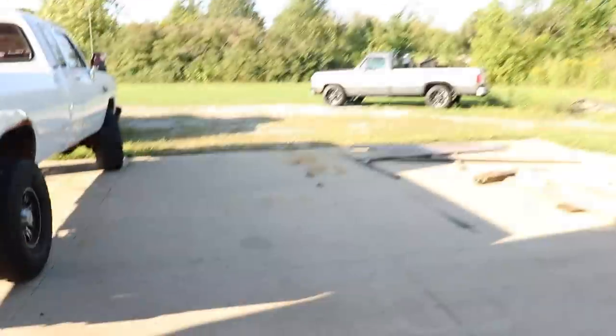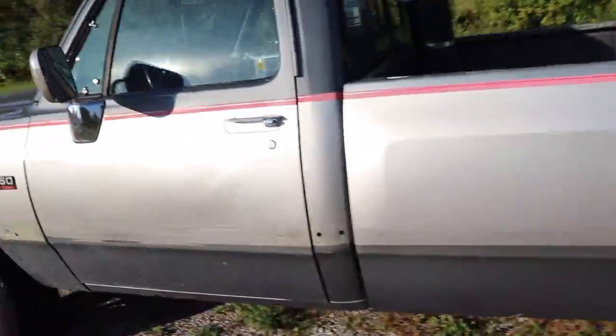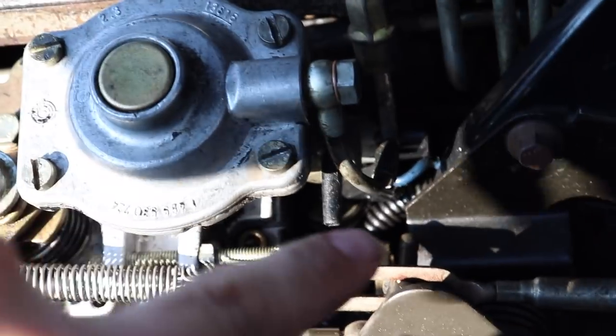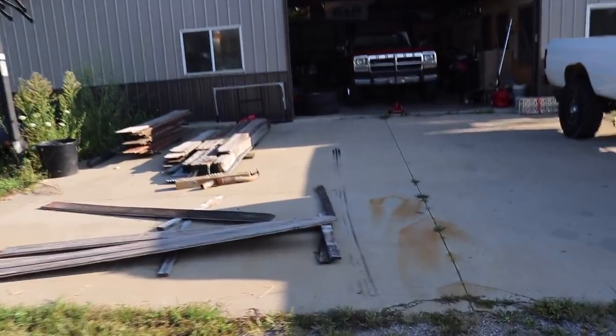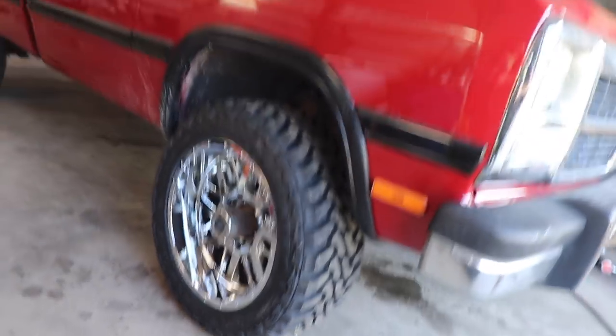I noticed the fuel issue on big red. Let me show you on this other truck as a demonstration since it's lower to the ground. It almost looks like a little priming button but it's not even really a button. It was just lopsided and loose — I clipped it back on and it was fine. You see this little spout right here? There's a little plastic fitting that spins around loosely and pops off easily. It was halfway lopsided hanging on the VP pump on big red, and once I clipped it back on the leak stopped — just a little thing.